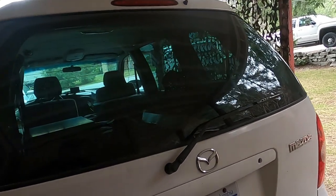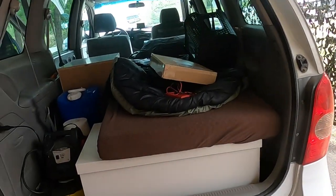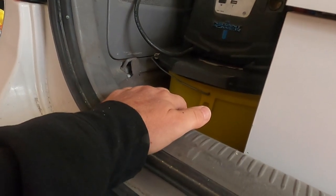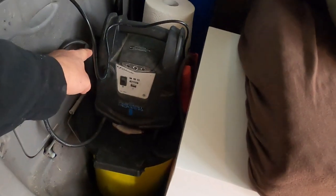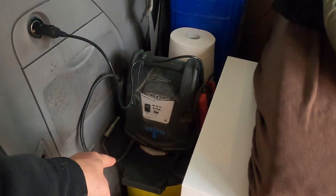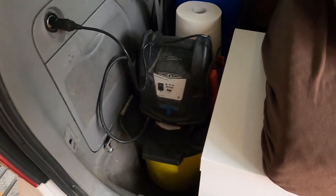I'm not going to need a lot of power when I'm driving and traveling, but I'll have to charge GoPro, drone, cell phones, and whatnot. Starting out, I've got a charger here, kind of a power bank — Instapower. It's an old one but it still works good. I'm going to take that and be able to boost the vehicle when needed. I can charge it with a 120 inverter plugged into the 12 volt, charge it while I'm driving, and it will always be charged up for additional power.